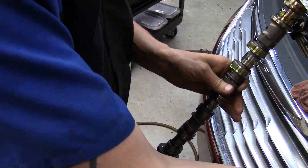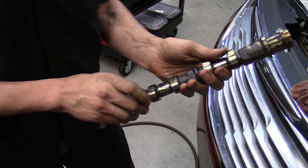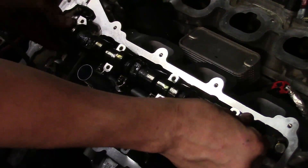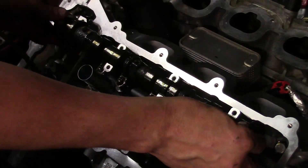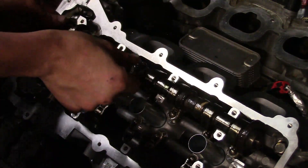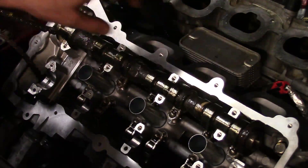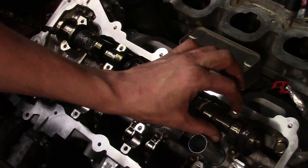I'll sit it back in its rest position — basically where there's not much spring tension on the valve springs and the cam lobes. You'll know you're in the rest position because as you're installing the cam it'll roll over to a spot and lay flat within the cam bearing areas. If it's any other way up it'll want to kick up because cam lobes may be making contact with the roller rockers. Make sure the holes are pointing almost straight up with the vehicle. Once it's making good contact and not kicking up, start putting the bearing caps on and gently running down the bolts. If using an electric impact, put it on a lower setting — don't use air, use electric.